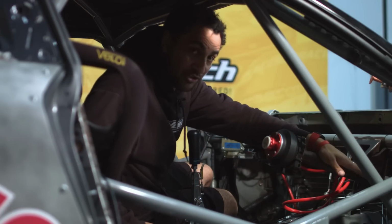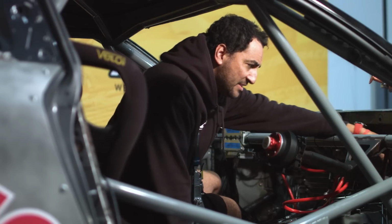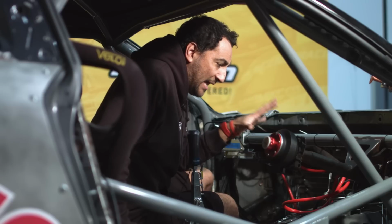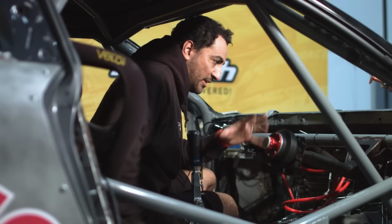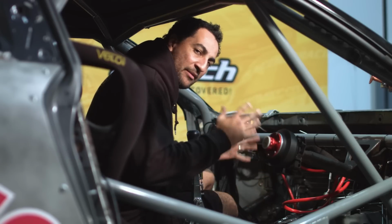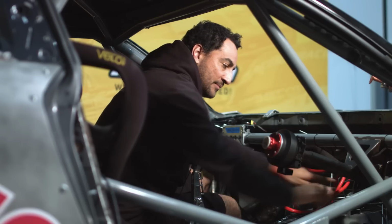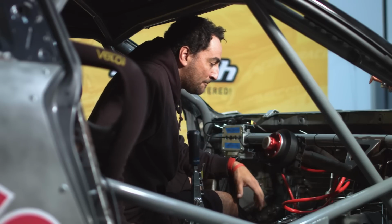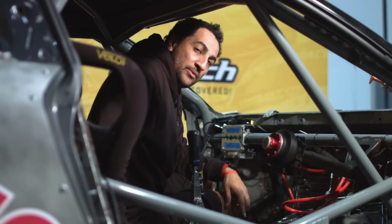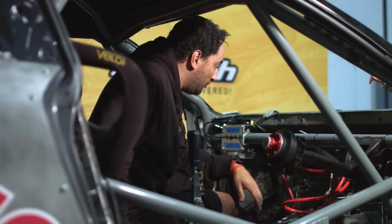We've also, of course, got a drive-by-wire pedal, which I've wired in. We've made provisions in the future for a steering angle sensor. Scott wants to be able to log that in the future, particularly against wheel speeds, braking pressures, and steering angles, to get the most out of the car that we can one day. Here we've got a couple of brake pressure sensors. They will be wired into the ABS kit. So we'll get onto that soon, but I'm going to move up into the engine bay to finish that side of it now.